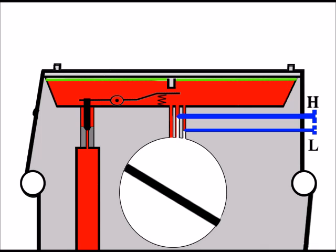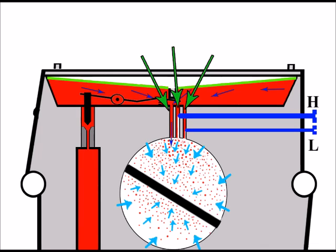I've actually come across times where it bogs down due to the low screw. And although the low screw is associated with fine-tuning low engine revs, when it's screwed in like this, it does cause enough of a problem with the fuel-to-air mixture to cause bog down. And in fact, I have found this on more than one occasion when I'm actually physically repairing machinery.